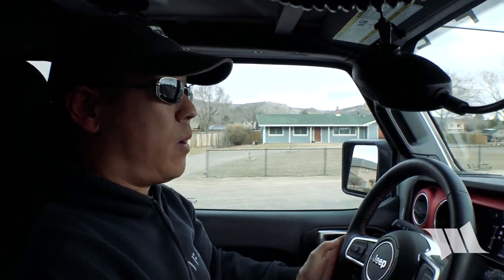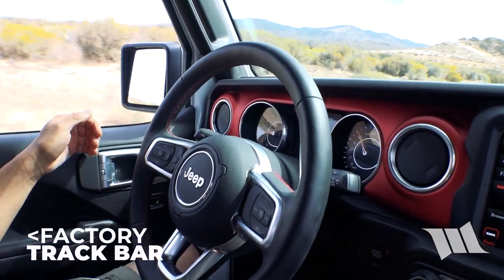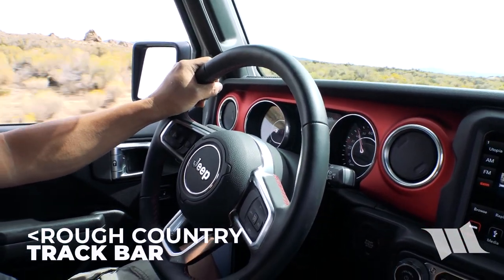We are going on a test drive now that we've installed these new Rancho track bars. We've been dealing with a little bit of a wobble or shimmy in our steering wheel — nothing close to being death wobble, but there's something going on especially when it's cold out. Right now it's about 43 degrees, on the cool side. We're going to go on a really rough section of road nearby just to see if these track bars are going to make a difference. When we were running the factory track bar, you could really see it. With the Rough Country track bar, it was a lot better, but it was still there — maybe not as bad, but still there. So we're going to see if the Rancho track bar is at least as good, if not better.